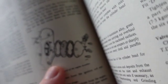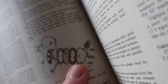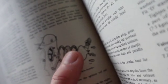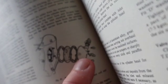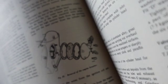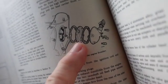This is the diagram of the front of the motor where I was talking about adjusting the cams. This is the EGR system, such as it is. And if there's an old Wheeler Dealers where they bought a Jaguar sedan with a 3.8 in it, I think, and there's a screen in here. There's a wire mesh screen, and that screen was clogged and it was all messy down the pipe. And it basically has a catch bottle like they use on modern cars, and it was clogged up and causing the engine to leak oil. They got lucky. So that's the engine breather right here.